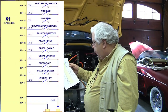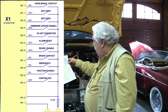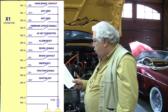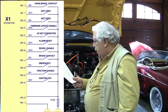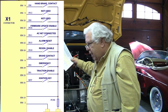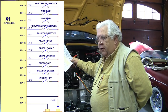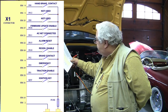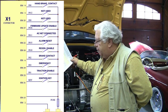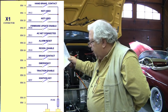Pins 9 through 31 on the right side are really enable/disable pins. Pins 9, 5, 35, and 37 are just general disable pins — if you put 12 volts on one of them, you disable the controller. Pin 21 is a specific disable labeled AC net connected. We have an output from our charger that we send to the eVision on pin 21 — it's simply a 14-volt output from the charger indicating it's charging. When you have the AC plug connected to the Brusa charger, that would in theory prevent you from getting in the car and driving away because the controller will be disabled.